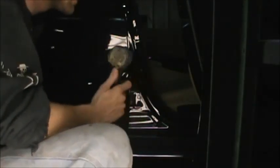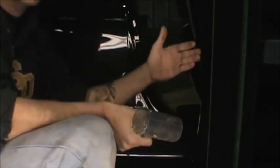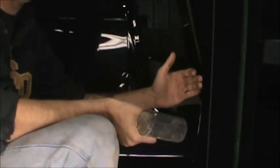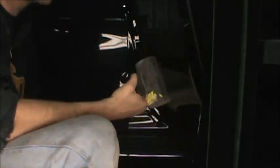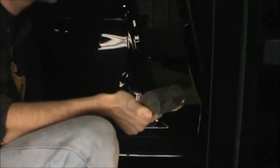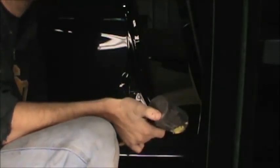All right, glad to see you back with us. This is my little friend I like on these types of repairs because I actually have to hit the interior of this door panel to straighten this lip out. And I don't really want to get in here and repaint and do all that if I can help it. So a rubber mallet or soft face, nylon, neoprene, where I'm not chipping and messing up the paint, I'm better for it.